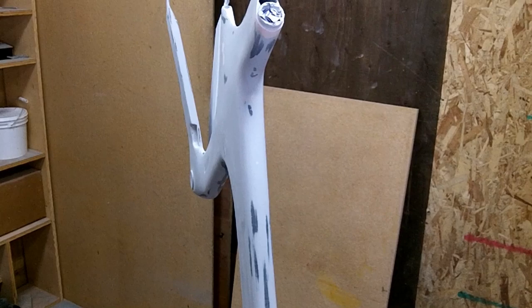All right, just got done priming this, and kind of wanted to show you. I don't know if you can see this real good or not, but this really brings out all the little mistakes or the lines that you cut. When I'm using a sanding block, it's hard to get those curves just right. You try to go on 45 and you go back and forth, and sometimes you end up with these little lines. So spraying this with primer really brings those lines out, those mistakes out.